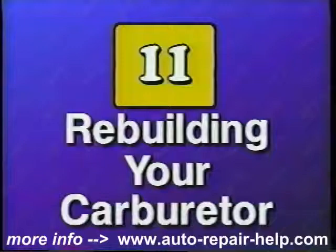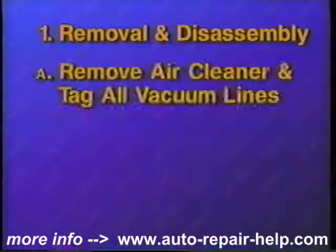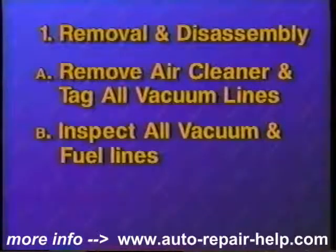Let's review the 5 easy steps for rebuilding your carburetor. Step 1, removal and disassembly. First, remove the air cleaner. Tag the locations of all vacuum lines. Inspect the vacuum and fuel lines and replace any that show signs of deterioration.